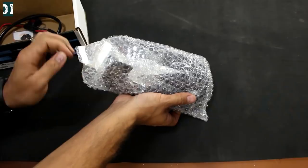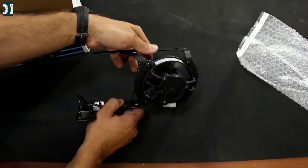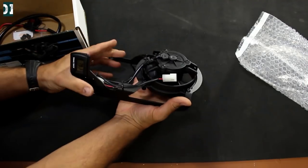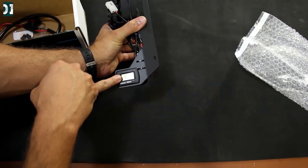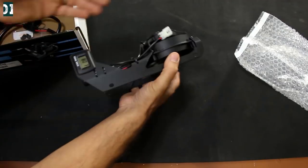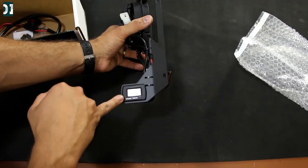This is the fan you're supposed to install on the radiator. It goes on the right side radiator. It's really nicely built, looks very tough and very durable. It comes with a temperature reader and you can set when you want the fan to come on — maybe 150, 170, something like that. You can decide when it comes on.